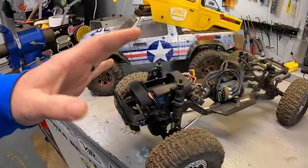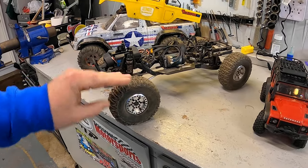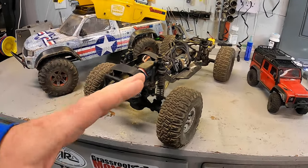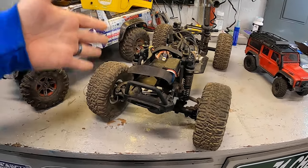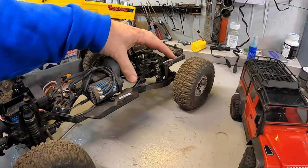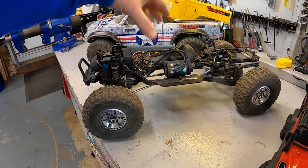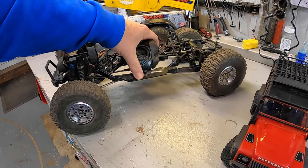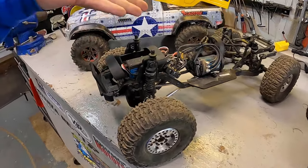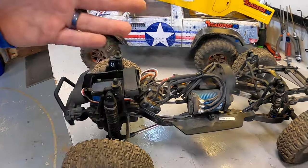The purchase price of the vehicle is just the start — you will quickly want to upgrade things. The typical order is tires and servo first — those are very important. Then make sure you have weight in the front and keep the rear as lightweight as possible. You do not want a tall crawler; tall crawlers tend to fall over more. So you'll look at what it takes to get the vehicle at an appropriate height where it can clear obstacles but stay as low as possible. Finally, look at upgrading the power plant itself.